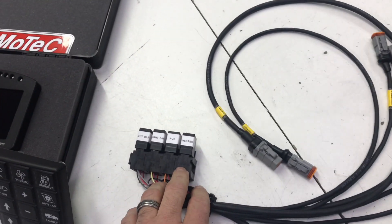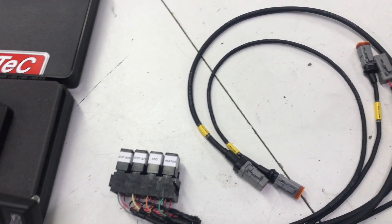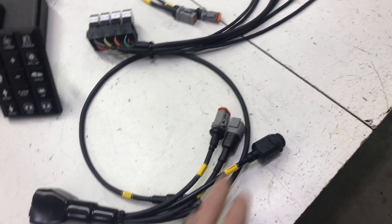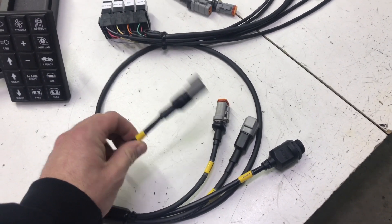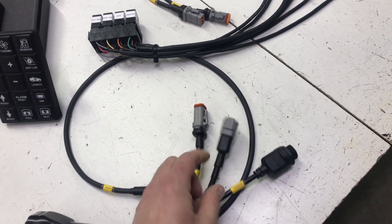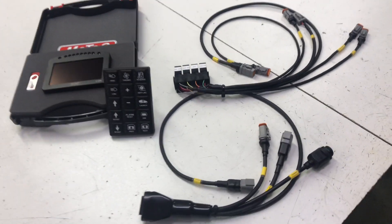In this case, we're going to control a heater that's on board, a transfer fuel pump, and two light bars. We've got the dash loom that we built here — pretty simple. It's got Ethernet comms and a keypad lead. It interfaces with the M130 here, and then interfaces with this relay expansion through this six-way DTM. Let's get in and talk about some of the functionality.